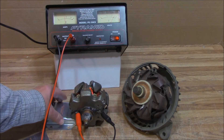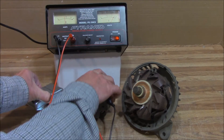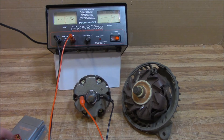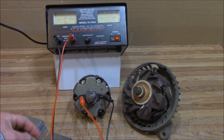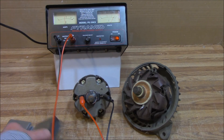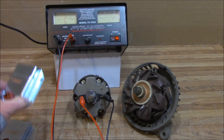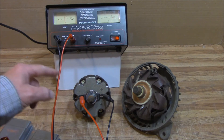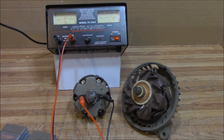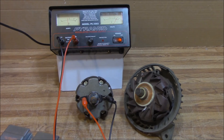You can see the rotors become very strong electromagnetic coils once you run power through them. With the C8312 — the basic auto parts store regulator from early Chrysler — the field draw capability is only about 5 amps. So if you're running 8 amps through it with the late-style heavy-duty rotor, you're exceeding that rating. With the C8313 heavy-duty adjustable regulator, you're not exceeding it, because the C8313 has a 10-amp field draw capability where the early one only has 5 amps.